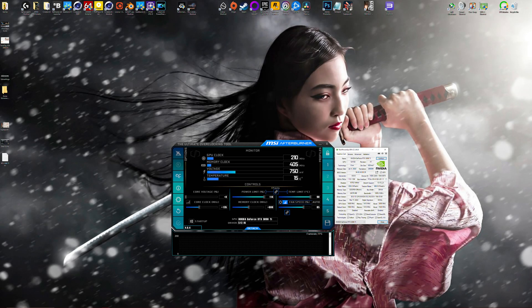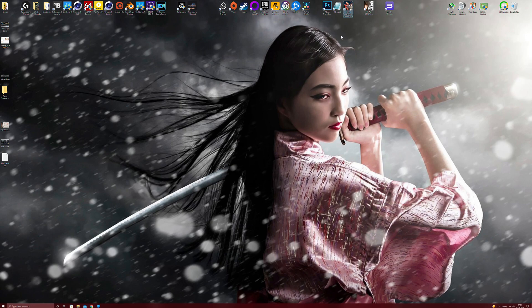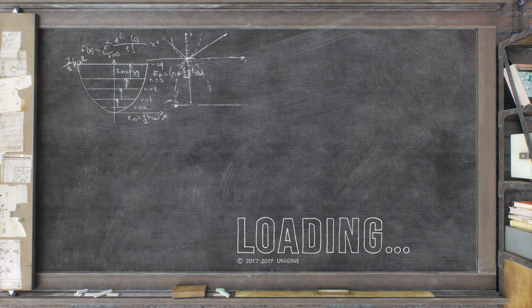Welcome back to the channel. Today I'll be doing some benchmarking. I'm just going to show you my settings: 135 on the core, 800 on the memory, and 114 power limit, 85 fans — usually I use 80 but I just want to keep things as cool as possible while benchmarking. I'm going to be running Superposition Benchmark, a free application, running a 4K optimized setting just to see what the RTX 3090 can do, and I'll present you with a score at the end.